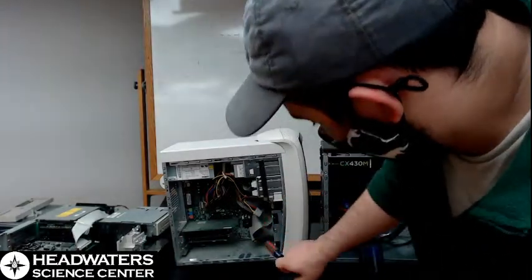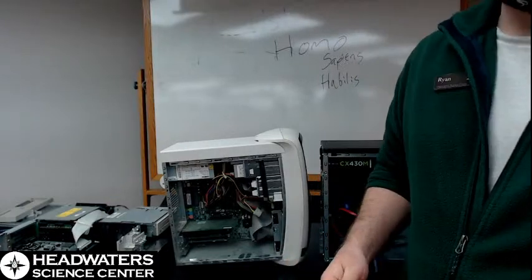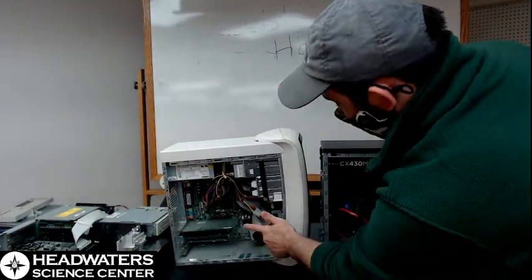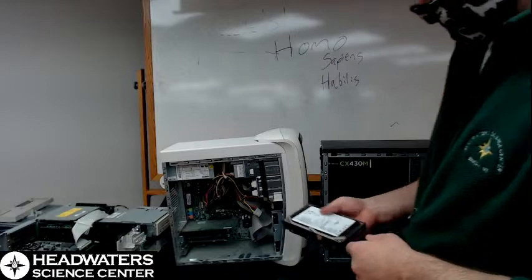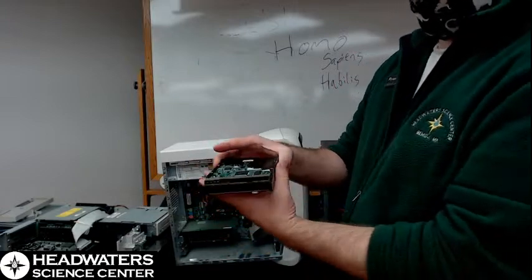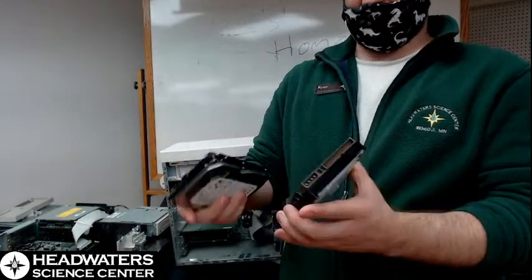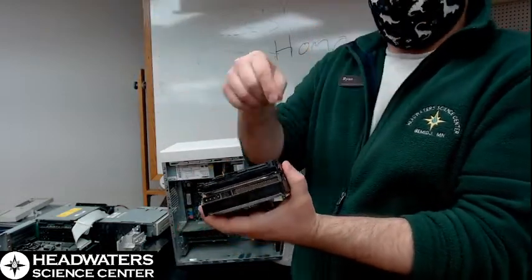This one, I'm not going to pull out because it's really buckled down in there, which is something that you see in a lot of these old computers: the parts are really in there. It's a lot of snapping and popping plastic components out. It's a lot of taking out screws. It's a lot of unplugging ports and unwrapping wires to get anything out of there. But what you'll see inside this one is a 3.5-inch hard drive with a PATA port on it. It looks something like this. That's in there, and this looks pretty similar to how modern 3.5-inch drives look. So this would be a more current one. It's a little fatter. The port at the end's a little different, but basically it's using the same format, just a little bit different connection at the end. You can just buy an adapter that would change this directly.